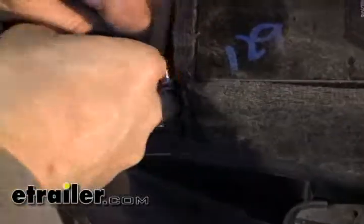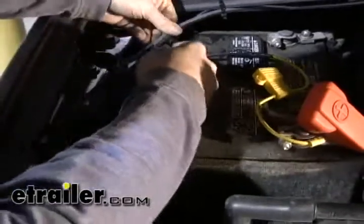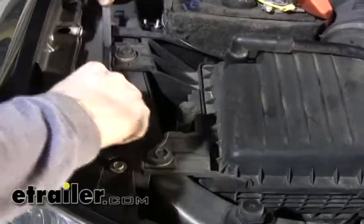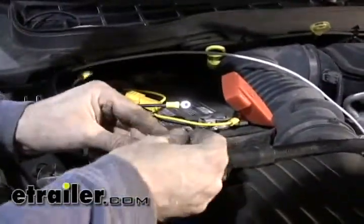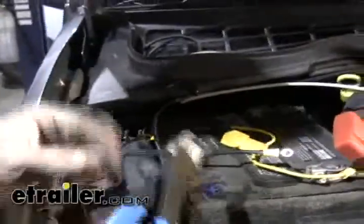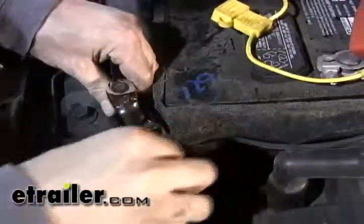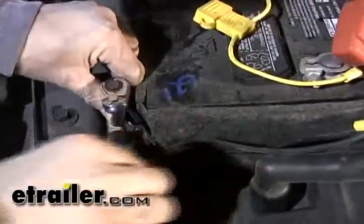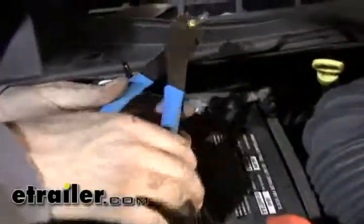Let's go ahead and mount our second circuit breaker — this is going to be the 20-amp. Pull back the sheath on this wire as well because the white wire is going to go to the ground and the black wire will go to the circuit breaker and then onto the positive terminal of the battery. Measure our length and we'll add the ring terminals again. For the other half of the short wire, we'll go ahead and add the large ring terminal. Going out to the brake controller, we'll use the silver post, and out to the battery, we'll use the copper post. For our white wire, that goes to ground — that'll be the negative side of our battery — and we'll add another large ring terminal to it.